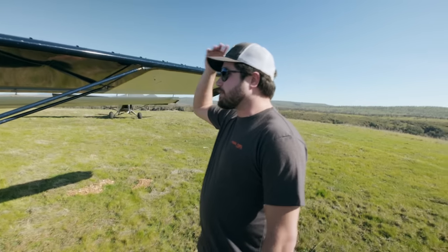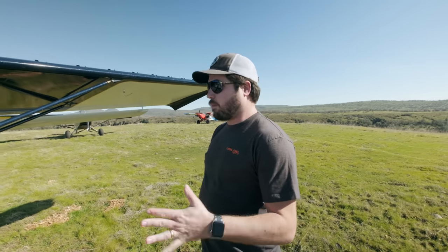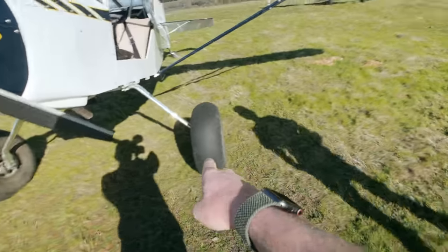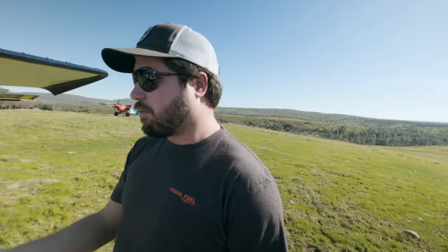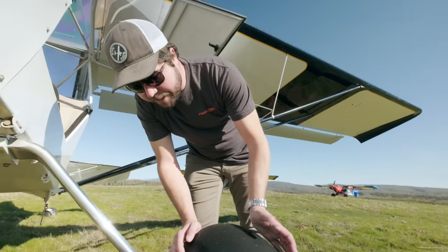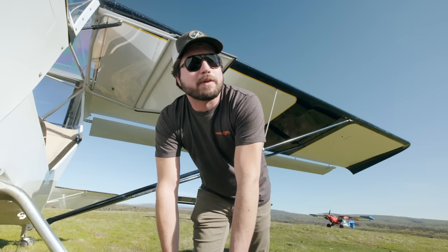It's like the same wing as a Model 7 stock, same engine more or less, and it's about 200 pounds lighter. Most Model 7s are between 800 and 850 pounds. This is 650 with what you see — big gear, big tires. The tires are not Alaskan Bush wheels; those are Dessers. The wheel and brake setup is stock Model 4 except I added another caliper. Desser makes these Aero Classics that weigh about 20 pounds a piece. They're 27 inches and they fit on the 8-inch rim that was stock with a Model 4, so they're like the perfect little combination for the airplane.